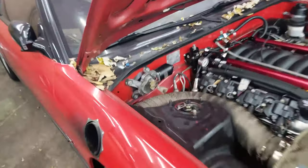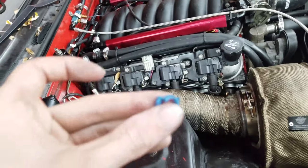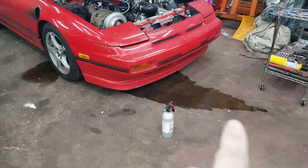So I got out here and started working. The first thing I needed to fix was we messed with the fuel rails on the 240 a couple weeks back and we pinched one of the O-ring gaskets going into the fuel rail. I went and replaced it - you can see right here, it's an O-ring on number three - and there was just fuel all over the place. I went and fixed it and thought I got it all seated back in the injector rail, which clearly I didn't.